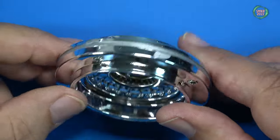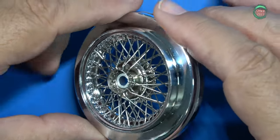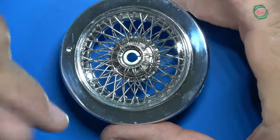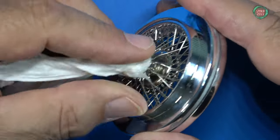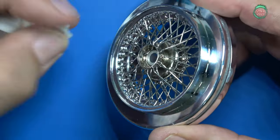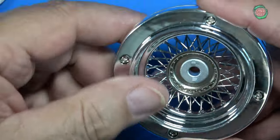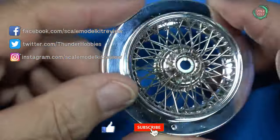The wheel is completed — everything works well. Remember not to use tweezers when trying to insert the pins through the holes, but you can use tweezers for alignments. The first two sets lay down in place no problem and can be secured. For the last two sets, put them in and let them hang loose. Use a cloth or paper towel — even a large eraser — to lock the pins in place. Smooth out all the pins on top, put the cover on, make sure all your pins line up, snap it down hard and secure it. None of the pins should be sticking out in the middle. And that's how that should look.